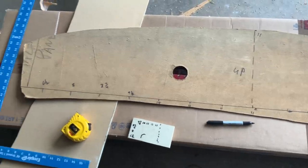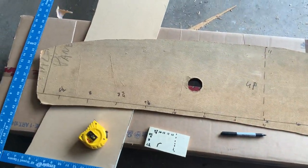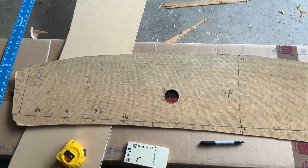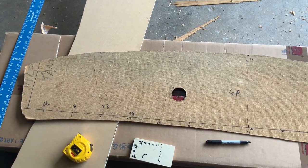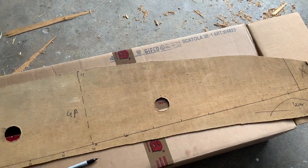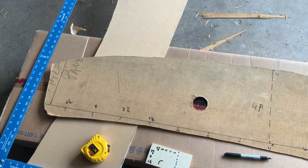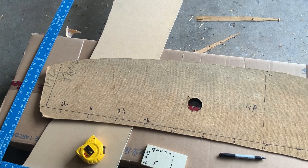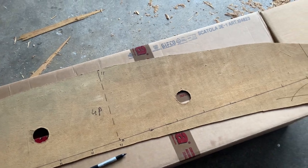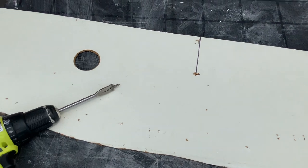What I did is I squared off on the front for my distance across, then from there I'm taking measurements every four inches to the rubber on the windshield, making my marks and joining the dots — same with this side — so I'll have my curve. I still don't have to go buy anything because I have this piece. We'll see what happens, and if it doesn't work it's a template.